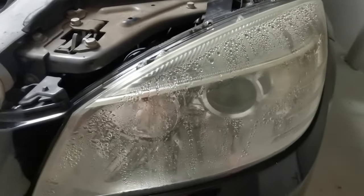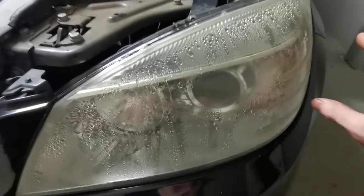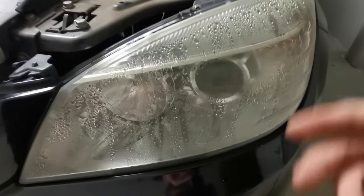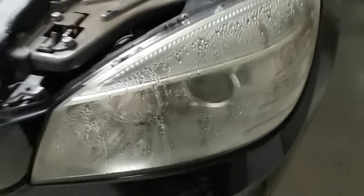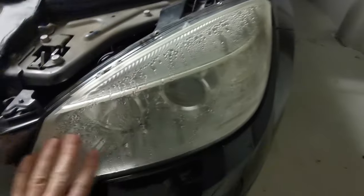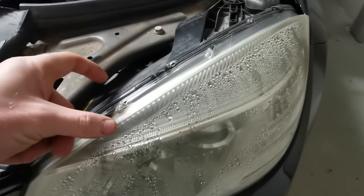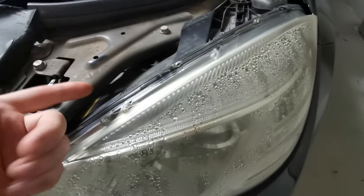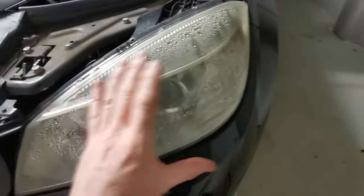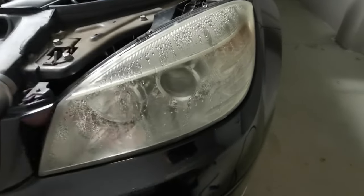If you don't have any of these items, there is one other thing you could potentially do — take off all the caps, take out all the bulbs, and on a hot day you could bring it for a drive and it may air out. I have also thought about, if the lens was damaged and you sealed it all up but the front was good and maybe a bracket got damaged, you could potentially create your own vents — drill in, reseal it well, and have a piping or tubing coming out where you're allowing the lens to breathe again.